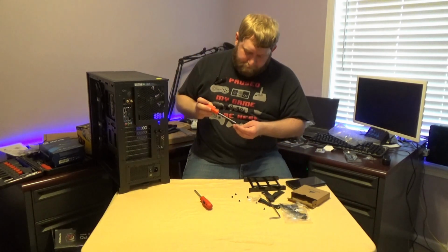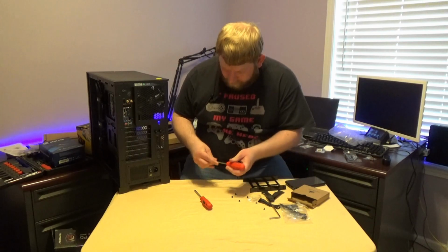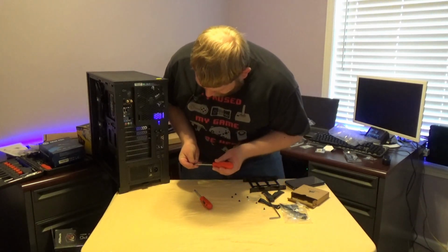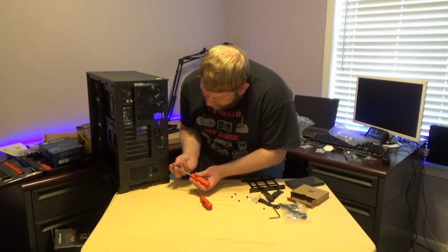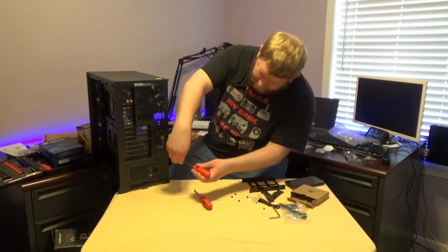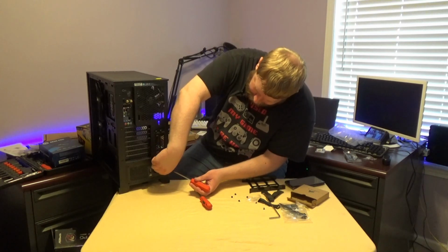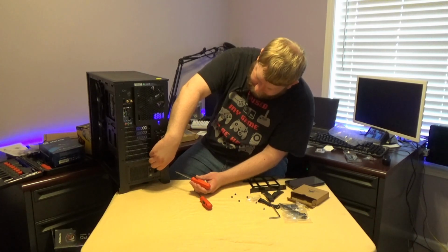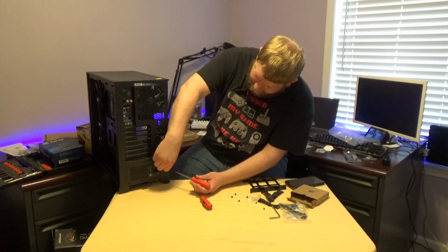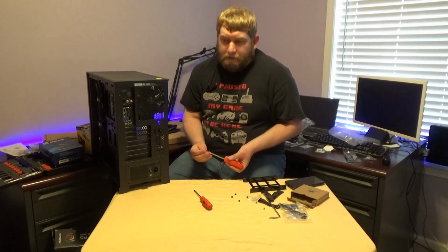Okay, I was confused. In this top corner there are actually two screws in the same corner that are threaded, and I wanted to make sure the one that I was going into was threaded as well. All 5 screws should not be necessary due to the metal case of the power supply. Any of these screws, one of them should ground the power supply to the case, but I may go ahead and use all 5 screws just because, might as well go overboard with it.